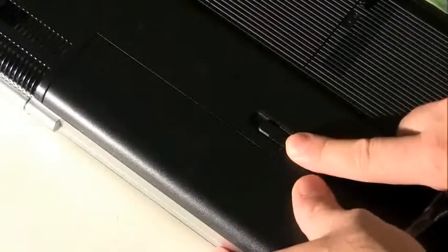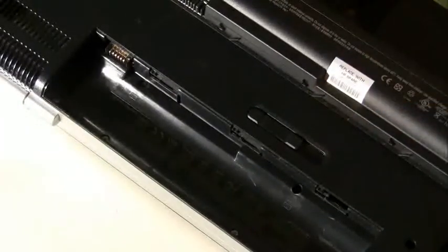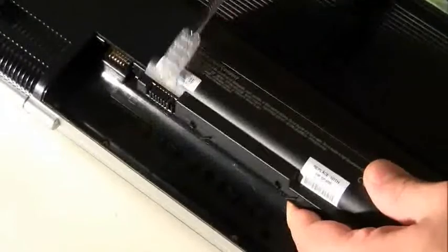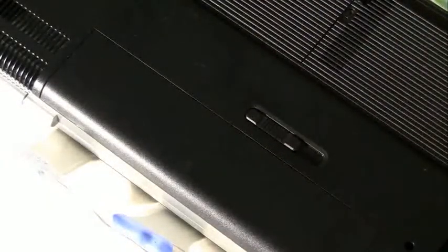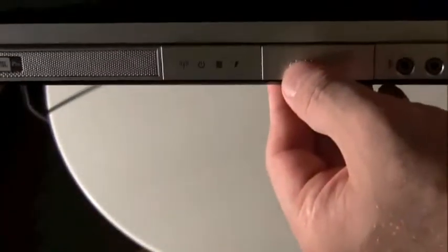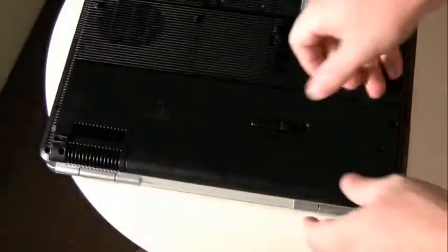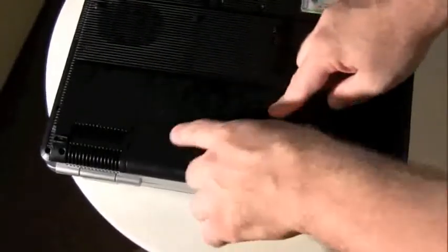There are some other reasons a battery won't charge. It could be that the contacts between the battery and motherboard are not making a connection — maybe something spilled in there or there's a film covering the contacts. Take a dry toothbrush and scrub between the contact pins of the battery and also where the motherboard connection is. Also try simply taking the battery out and putting it back in — sometimes a motherboard malfunction clears up and it starts charging again. Try rebooting and removing and reseating the battery once or twice before determining the battery is bad.